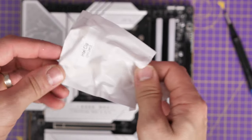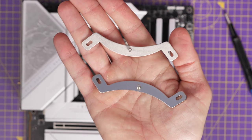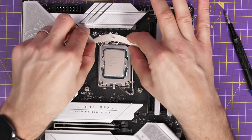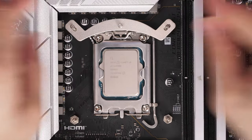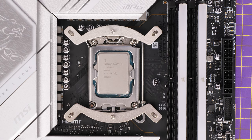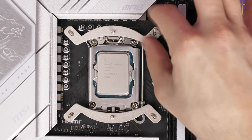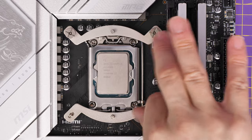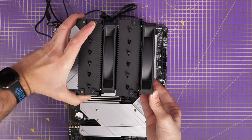With my hand holding the backplate in place on the back of the motherboard — making sure I'm grounded to avoid static damage — I screw the standoffs in. Once one or two are secure you can set it back down and secure all four corners. Then there's an Intel clip — a bracketing system — which goes over those standoffs and is secured with thumb screws. This clip works with different Intel socket setups: you'll see three notches/holes for various sockets. On LGA 1700 it sits in the middle of those three holes. Tighten the thumb screws down and use a screwdriver to fully seat and secure it.